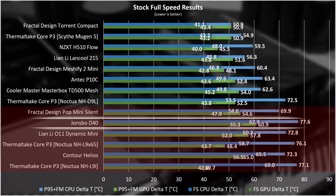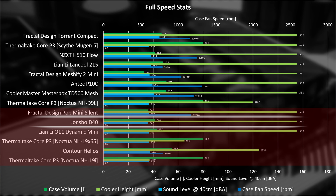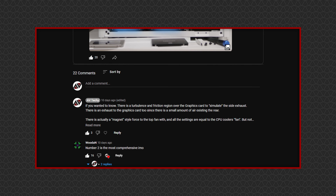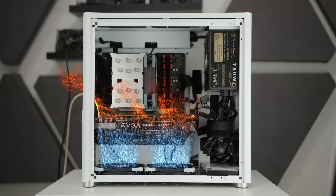Now let's discuss thermal and acoustic performance. Firstly, the stock full fan speed testing performance was awful since this case comes with no case fans — it's quiet, but to a fault. I advise getting some case fans if you plan to push any system at least moderately. Moving on to some fans and noise-normalised testing: due to the non-standard cooling configuration, two base intakes seem to be the most sensible place to start. Intakes are by their nature restricted by filters, so more intakes than exhaust is typically a reasonable approach.